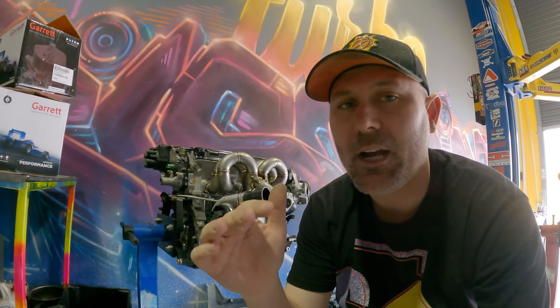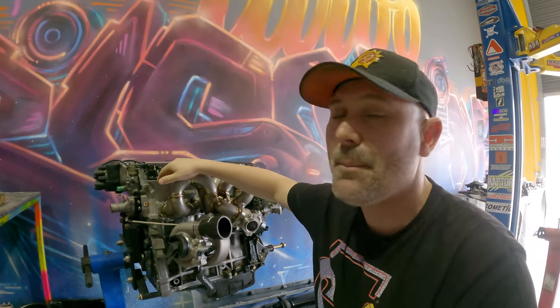We talked about the max peeding rods, put some brand new pistons in there and gapped the rings down. The head's been machined, I've honed the bores so there's no score marks in them and it's got a nice cross hatch pattern. We've put some ACL race bearings in there and some ARP head studs.